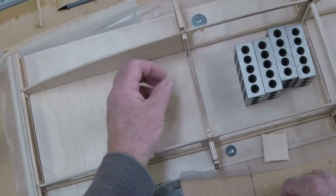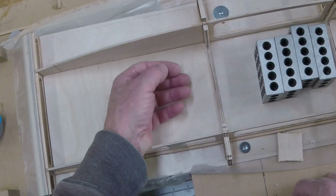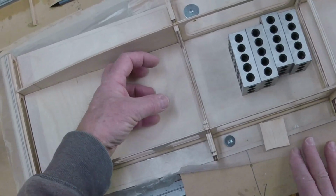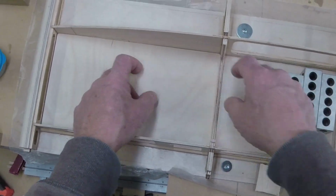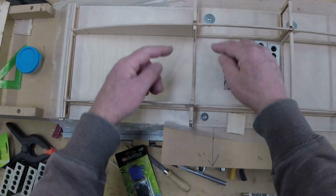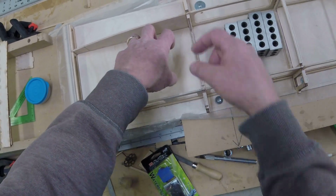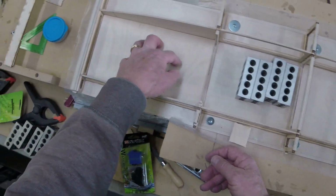Did I give you two reasons? Let's see: racing, cable, solid drive, lower center of gravity. Yes, I think that's two main reasons. The third reason I can't recall right now, but I'm going to tell you. Oh, yes, I know why. When you put a nitro in here, you're going to have to be able to get the starting belt off and on the round cylindrical thing that has a notch. Flywheel, thank you. The flywheel is going to be right here, and you've got to be able to get the belt in and out. If you bang the flywheel down against the floor, obviously you can't. So your motor would have to sit up way high to give you that room, and we can't have that. So there will be an engine well here that we will cut out later.